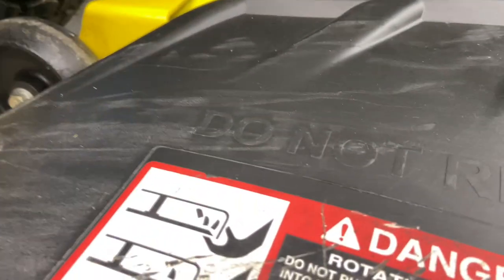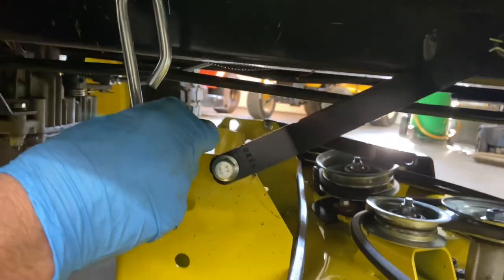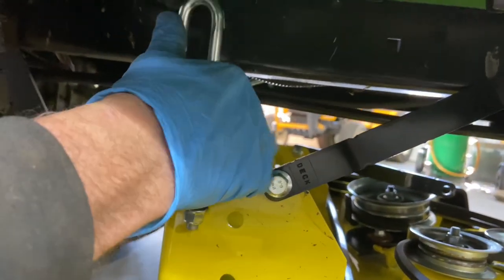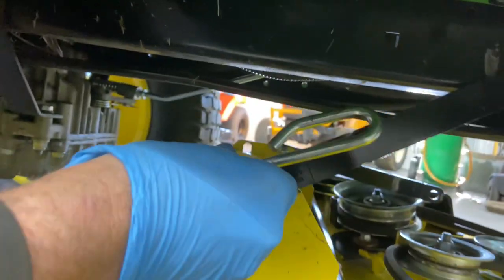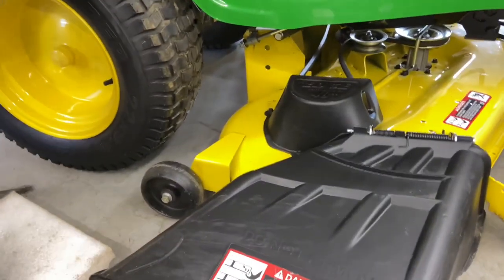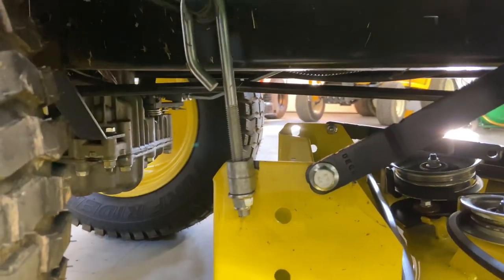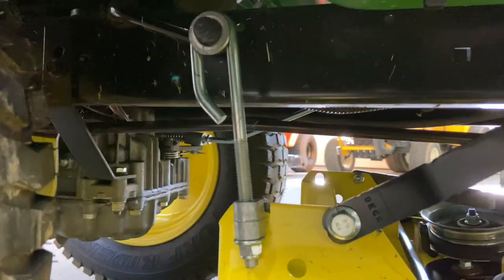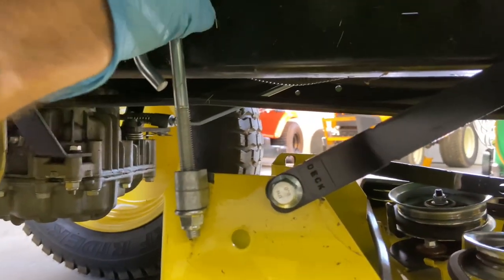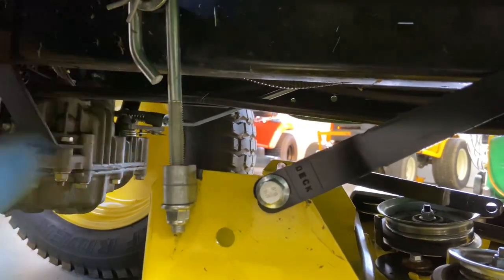When you come back to the back, again 90 degrees up, and make sure that your U-shape is facing the rear. I'm going to put the pry bar underneath and lift up on the mower deck — then this will go right on real easy. Put the washer on, like so, and then the clip. It's kind of hard to see; not really a good light angle, but it's on. Other side.